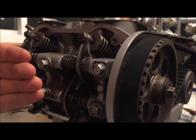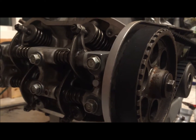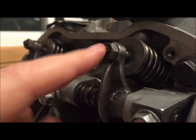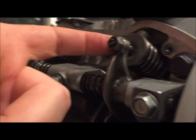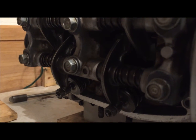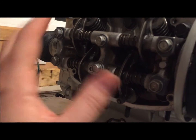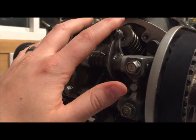When the motor is running, the piston is all the way up at the top of its stroke and the spark plug is firing, exploding the gases to give the power stroke shooting the piston back down. So both rockers are going to move — you can hear and see the tappet adjustment rattling because there's a little clearance between the adjuster and the tip of the valve stem. Both intake and exhaust are wiggling, confirming we're on the compression stroke. Remember: the two rockers on top are intake, and the two on the bottom are exhaust.